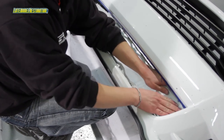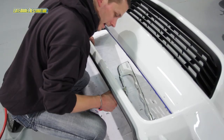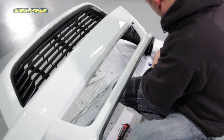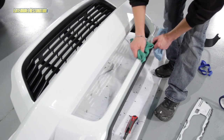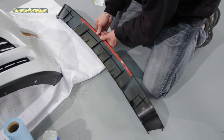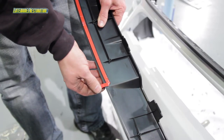Once the backside of the grill recess is removed, the cut section should look something like this. Clean up any rough edges on the bumper with a blade or file. Wipe down the bumper with alcohol and do the same for the lower mouth trim. Apply adhesion promoter to that area. Install the tape onto the trim piece, leaving the red edges showing.